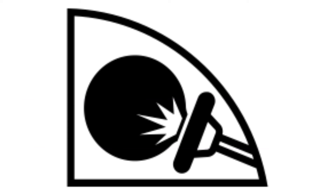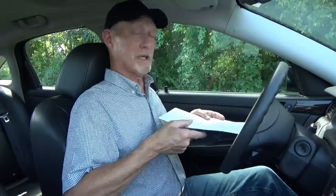There's an airbag in your steering wheel, and when it deploys it comes out with great force. If you're too close to your steering wheel and that airbag goes off, it can really hurt you. I've got a piece of paper here that's 11 inches on this side so I'm going to use that as my gauge — putting it on the steering wheel, I still have a few inches between the steering wheel and my chest.